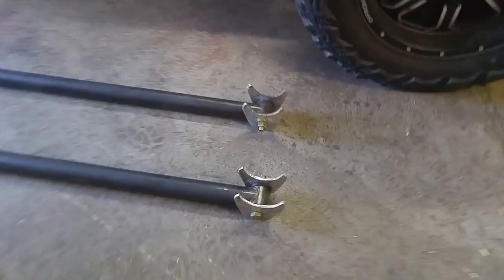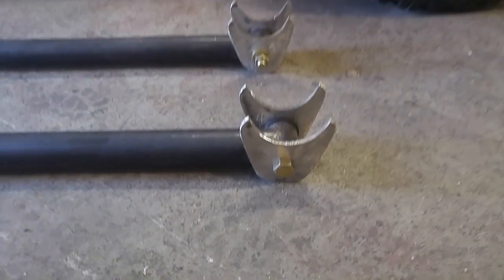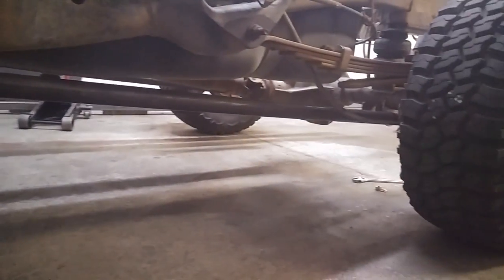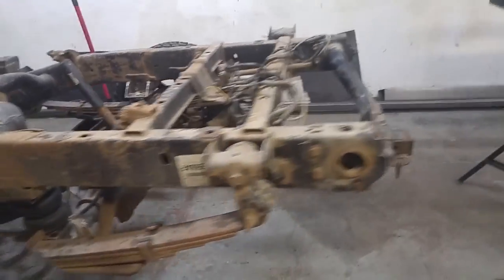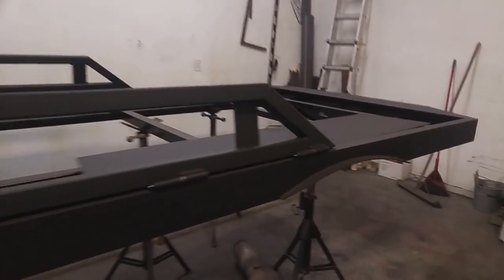These brackets turned out pretty good. I could save these for another set of traction bars another time. I got these traction bars up here - well, just tacked anyway, but that looks pretty good. I'm just about to pull them off right now and brace them up so they don't warp when I'm welding them, and then I'll weld the heck out of them. Hopefully today I should be able to start getting this thing on there - that'd be pretty cool.